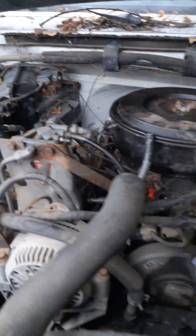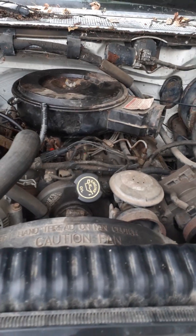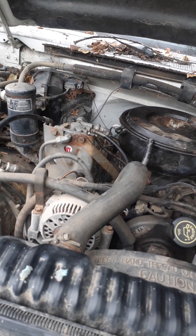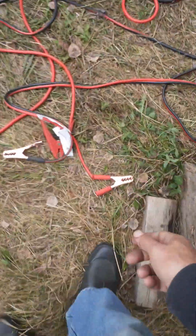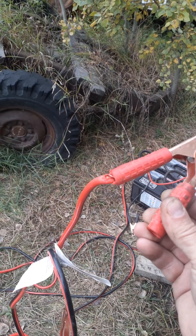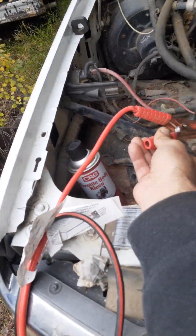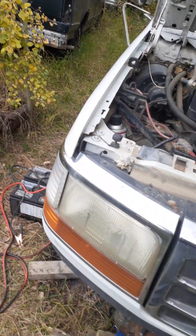I've been trying and trying yesterday to get this to start and it wouldn't. I realized the fuel shut-off solenoid needs power — I had this powered up and it melted my cable. That's how I was giving power right here to this terminal. The key is on and maybe the glow plug circuit is just taking too many amps.